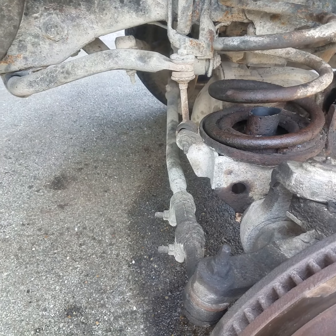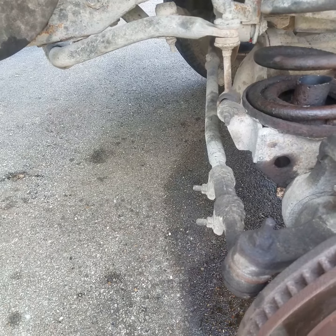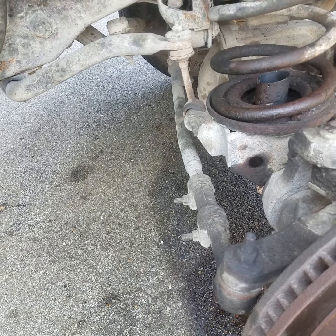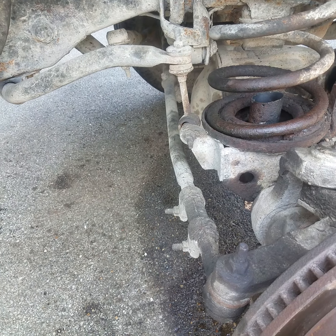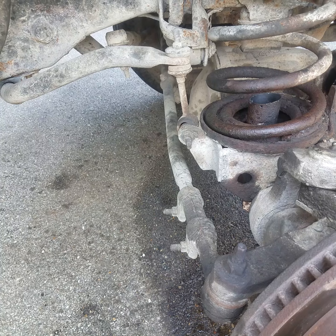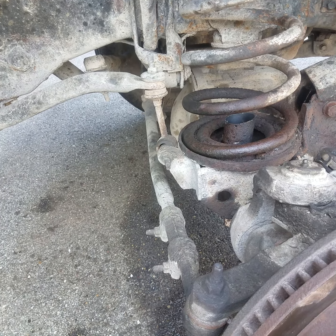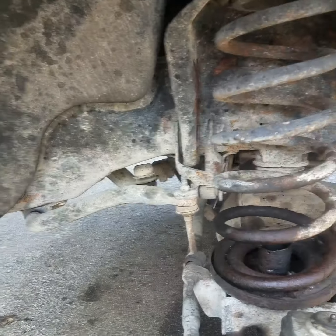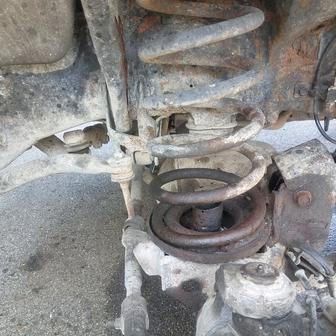Also, make sure you have some type of eye protection, whether that's a welding shield, a face shield, or some tinted safety sunglasses, because the heat and the light from a torch can distort your vision and ultimately affect your vision. So make sure, safety first. If you need a pair of welding gloves, make sure you use some welding gloves, or have them on standby just in case you need them to grab a hold of something and put something out, or, like I said, worst case scenario for safety.